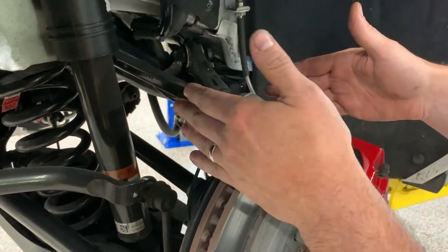So this BMR kit has what's called a lockout kit, and this prevents the lateral link from actually moving anymore. This little spacer that they supply locks this link in, which eliminates the eccentric. Now you essentially have just a rod with rod end adjusters, just like a tie rod up front. We'll go over to the workbench — I've got the other side completely taken apart and I'll show you the control arms over there.